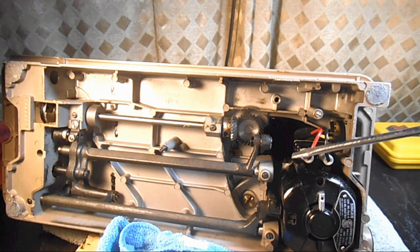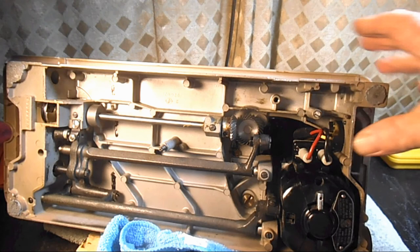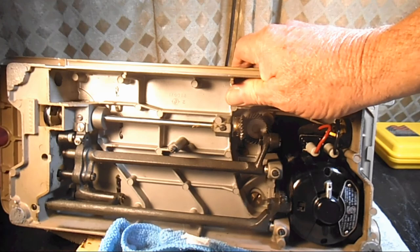If you don't have an offset screwdriver, what you can do is come in here — there's a screw here and a screw up here that take this bracket out. Or you can loosen the screw on the terminal — the little two silver screws — and push the terminal in. You'll either have a small hole there to put a regular screwdriver through, or a larger hole if you take the whole cover plate out. Then you could come in from over here through the hole and right into the adjustment. You could almost come in from an angle too.